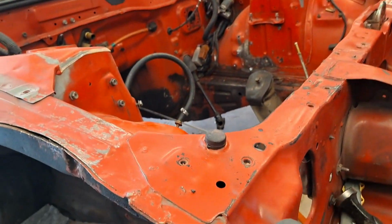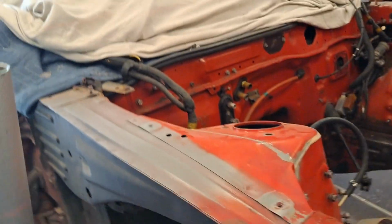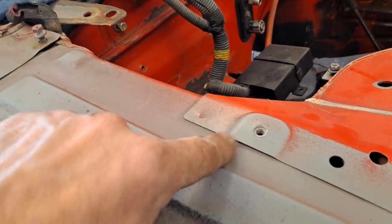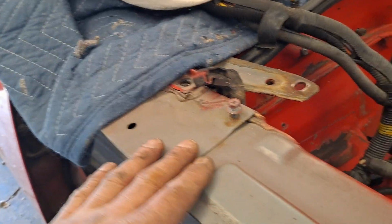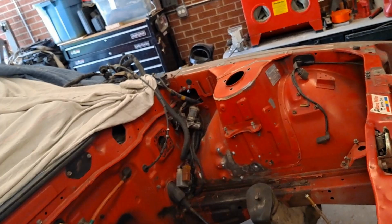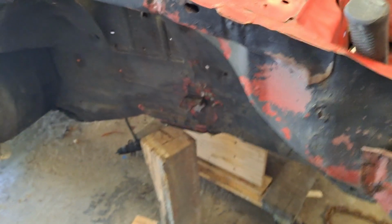It's carb day, I believe. And continuing to measure with the laser, and continuing taking points off of bolt holes, high ridges, just stuff that I know is clean, looks good, and should be straight and true. Even like this little pad here. Anywhere there's a symmetrical point of location, that's where I'm measuring. And I think we're in great shape.